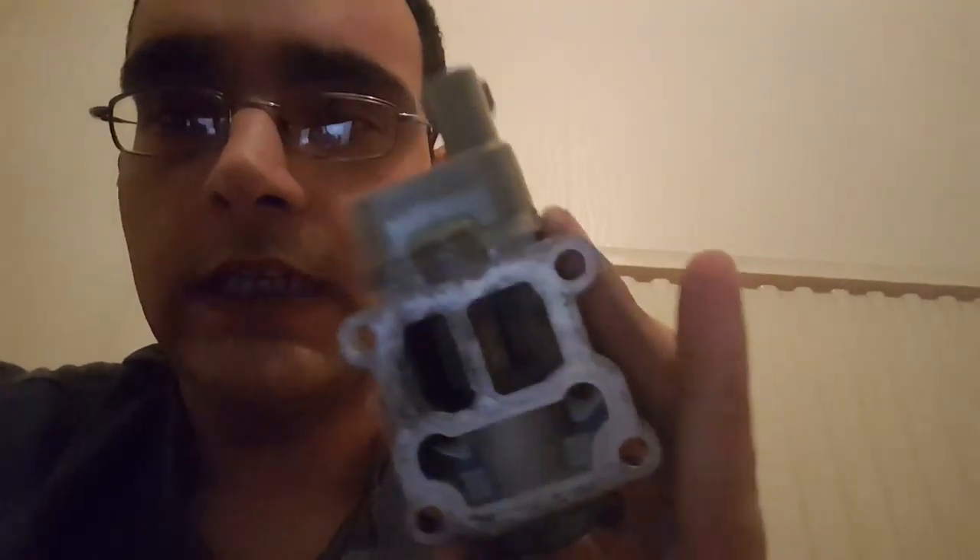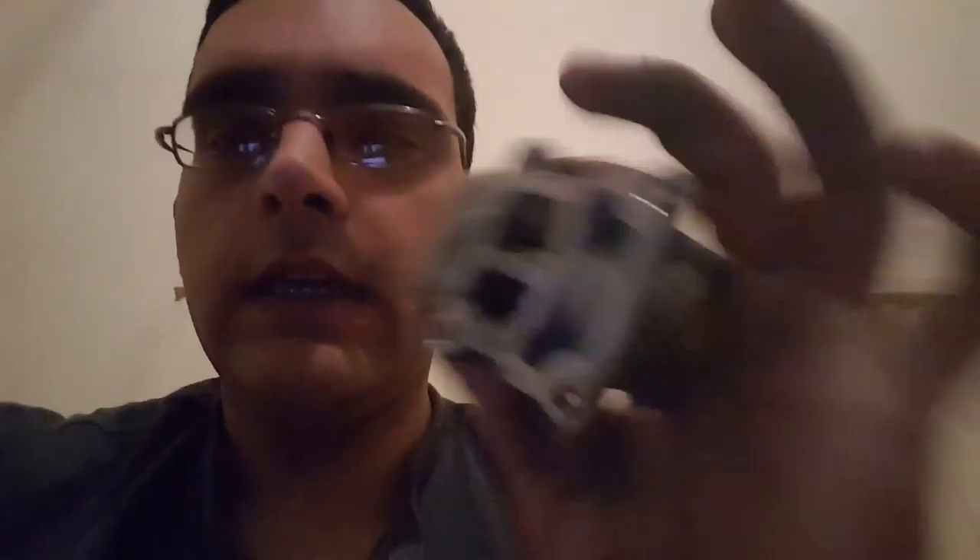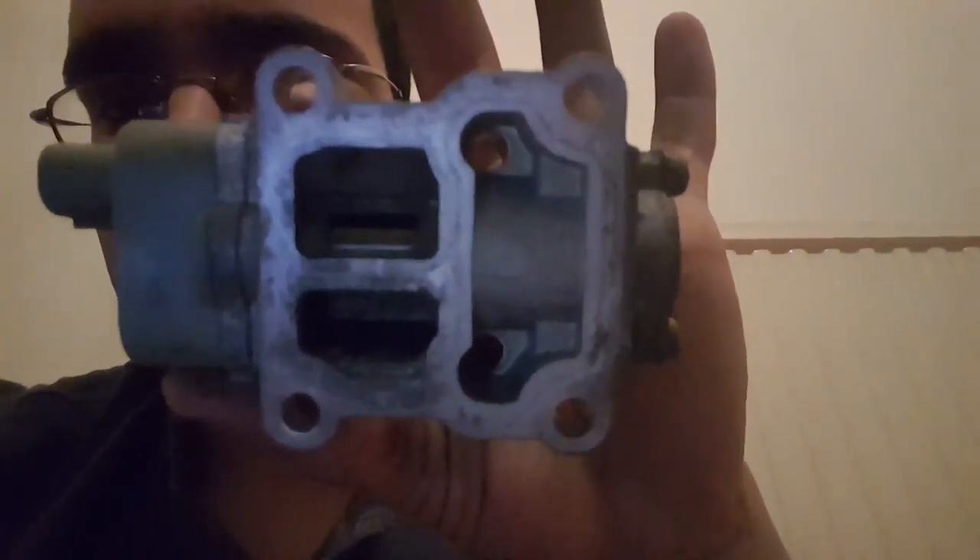You know what to do now — take it off your throttle body. Once you've got it off, you want a Phillips screwdriver. Take that sensor off, undo your two screws, take the sensor off. There'll be a metal pin — it should be moving freely. If it's not, carb cleaner from Halfords, about seven pound. Clean it all out. When it's back on the car, disconnect the battery for 10 minutes to reset the ECU, plug it back in, go for a drive. Trust me — mine works now.